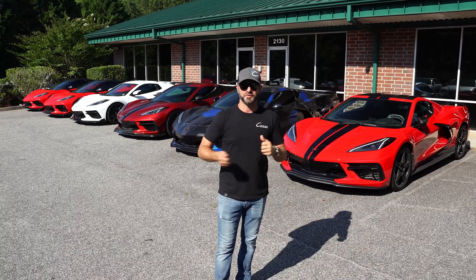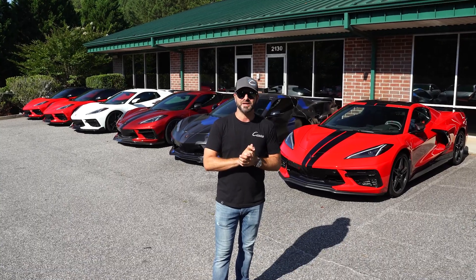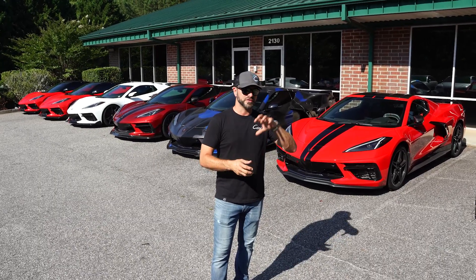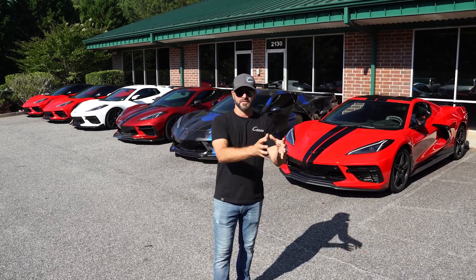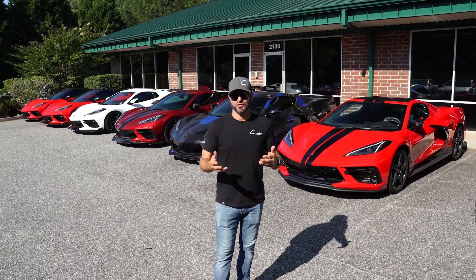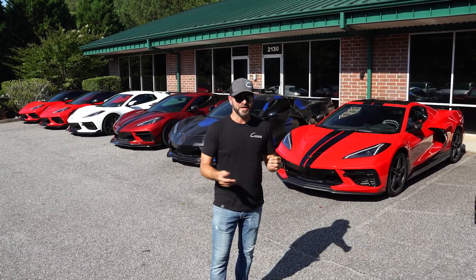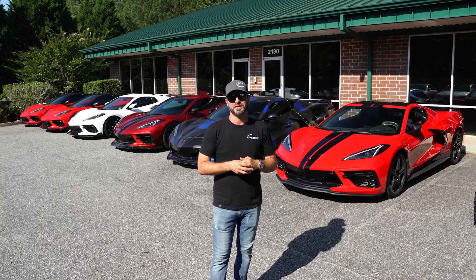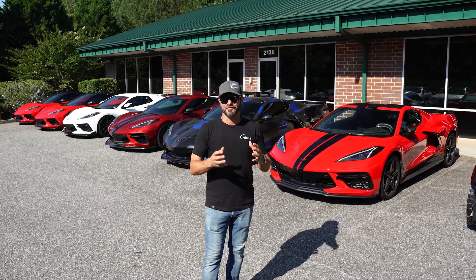It's a little bit more cumbersome than just being able to put the car on the dyno and tune it, but we don't care at this point. We just appreciate them putting the time, the effort, the R&D money into doing it. So the car comes here, you pull the ECU, send it off, they charge a certain amount to unlock it, they send it back, and that gives us the ability to tune the car. This wasn't a partial unlock — they literally dug into this ECU and gave us pretty much access to everything we needed.